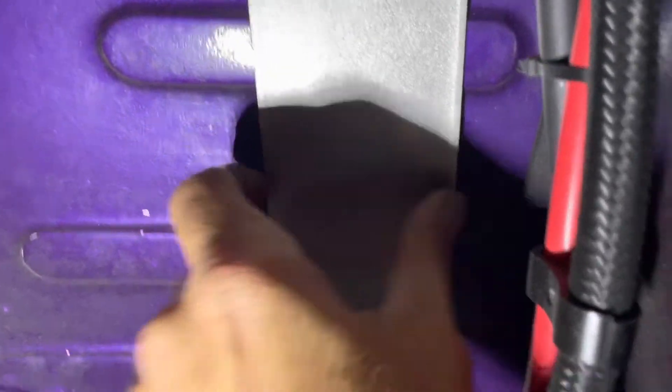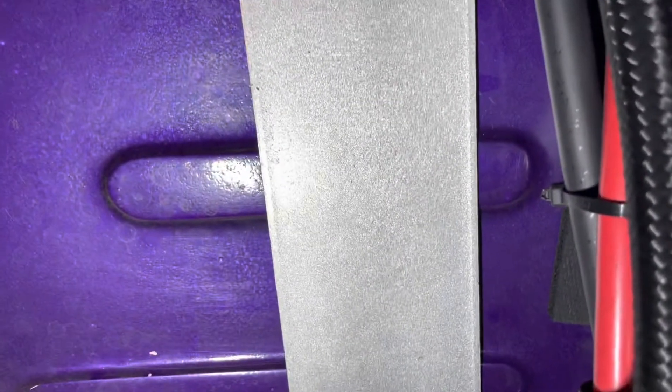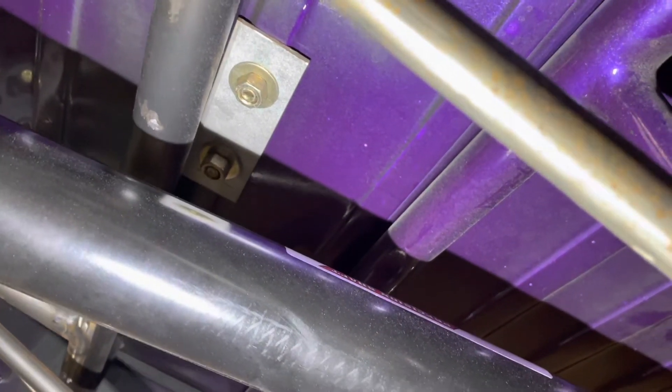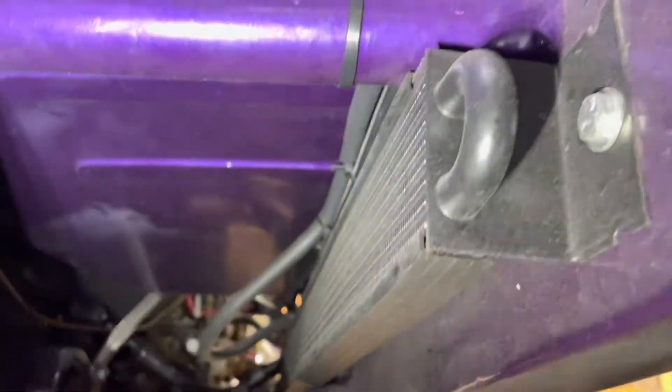This is what I was talking about — see how I've got it bolted here and bolted here, using eighth-inch plate to sandwich the body in between it. Up top there's also eighth-inch plate to help out. I also did it right there by the roll cage, and that's where my lap belts bolt to in the middle. On the outside I bolted them right directly to the frame. Those were actually tight.